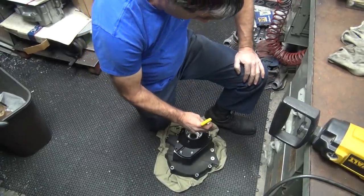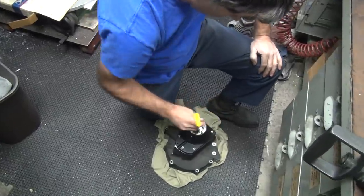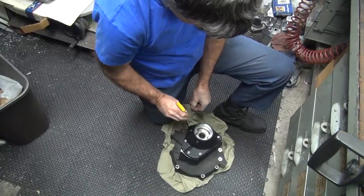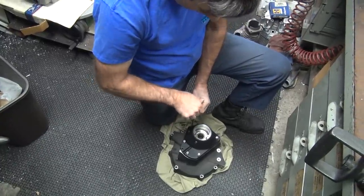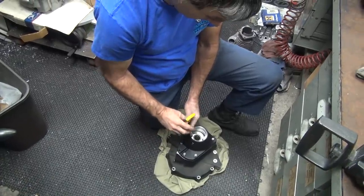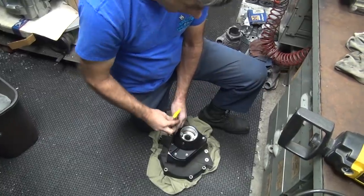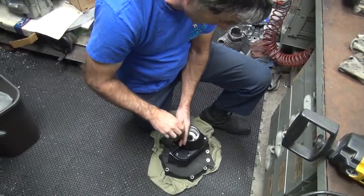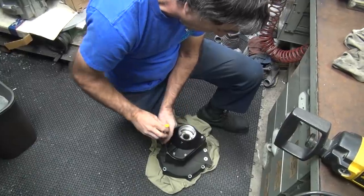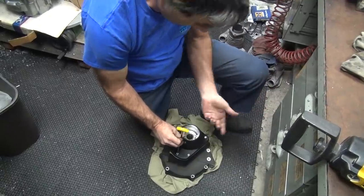Problem is, every motor, every cam cover has different locations for everything. There's always a tolerance, and the tolerance stack is what screws you. You can be a little bit off here and there on all the spots, and it just screws everything up. And that's assuming the bushing manufacturer put their hole in center. If it's off, you're really screwed. All those little alignments, everything makes a difference. If the bushing cocks on the cover a little bit, that kicks it over. That screws you right there.